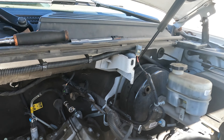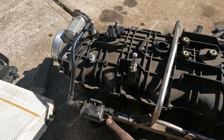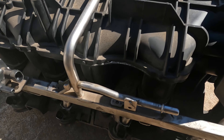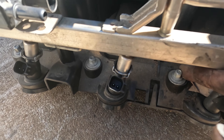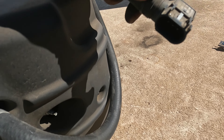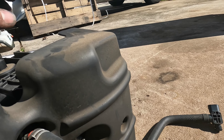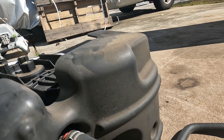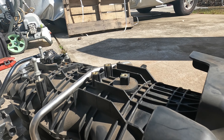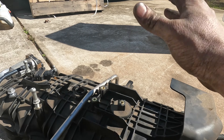Here's the intake. You can leave the fuel rail on with the actual purge valve solenoid — you don't have to disconnect it. Here are the bolts as you can see. This is the vacuum line for the brake booster, and it does have a sensor on this one that connects to that line. The reason I left that on is because this cover right here can be a little hard to pry off — it's got rubber grommets on the back. You just have to push down on the top of the cover a little bit and then it'll slide right out.